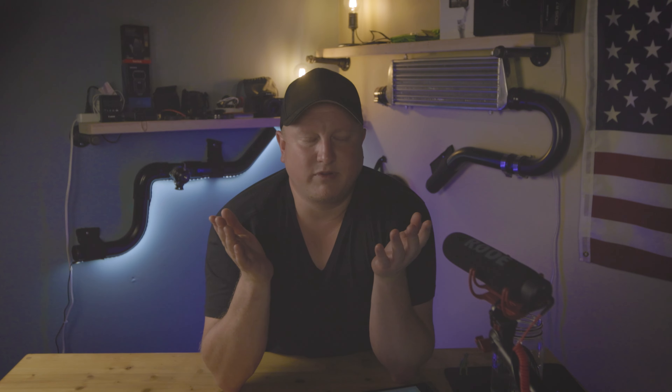Examining the rear differential further, I concluded there was a little human error on my part. Every time I jack up the rear of this truck I jack it up by the rear differential — I've always done that with all my other vehicles, never had a problem. This time, the little plate on top of the jack must have been turned ever so slightly, and that plate created a tiny crease in the rear differential cover, which caused a small leak — right in the same spot we'd been dealing with this whole time.